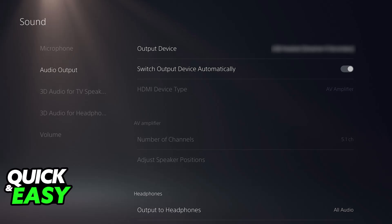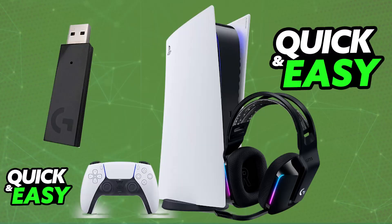If you are having trouble with this connection, first try using a different USB port, restart the console, and lastly make sure that the headset was sufficiently charged. You might need to do a full charge the first time that you use this specific model, so let it charge for a few hours, and once that is complete, just follow the same instructions with the provided USB wireless adapter and power on the headset.